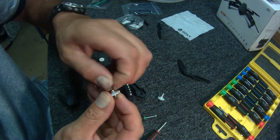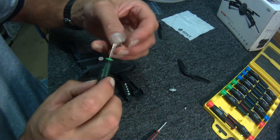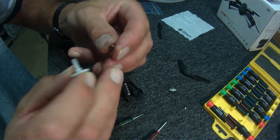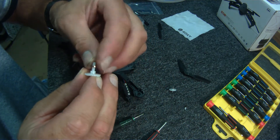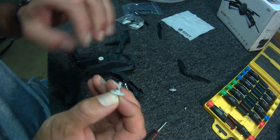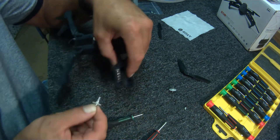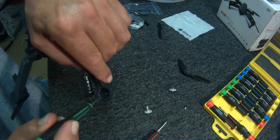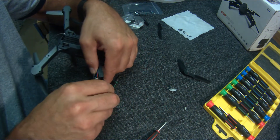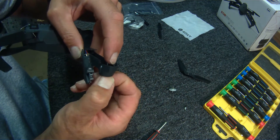I'm going to take that right off of there and that will pop straight off. You can see it's a small copper spacer. Make sure it's tapered correctly - the wide bit sits at the bottom, the narrow part at the top. If it's in the wrong way, it'll just look funny - it's got to taper down. I won't put any more grease in there - a little bit too much grease is no good. That copper spacer sits inside this part here so that it has a nice free play. Just push through there - looks like it's spinning okay.